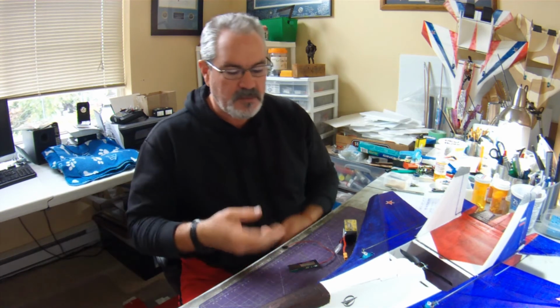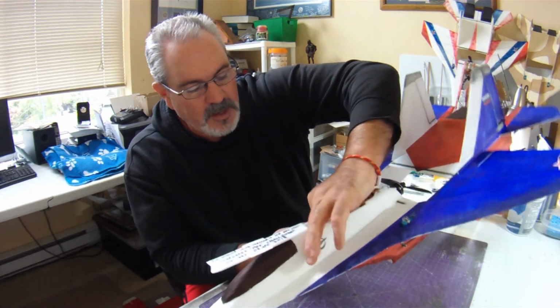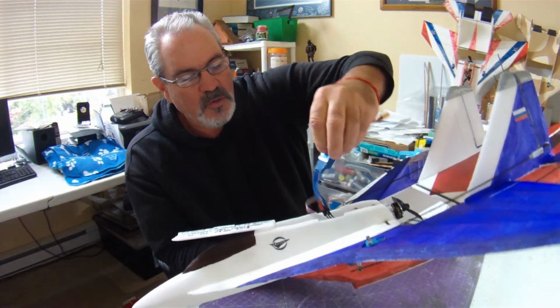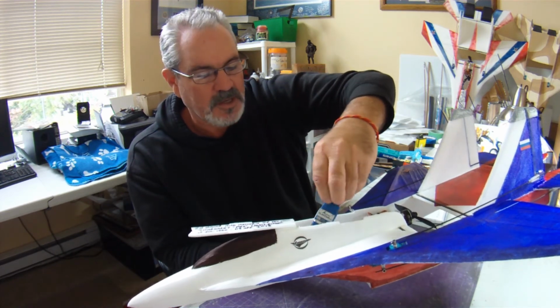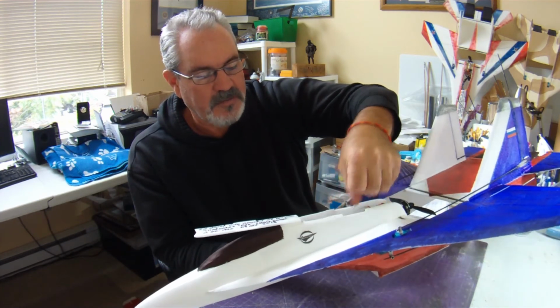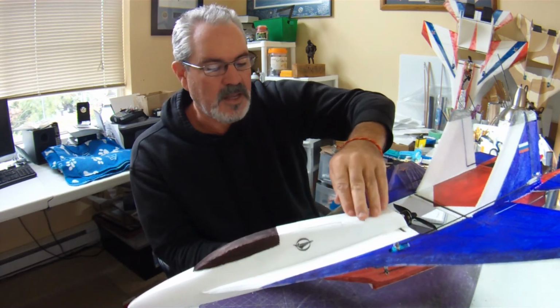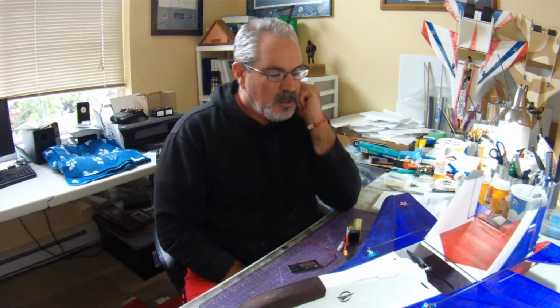We've got the GEP RC motor in here now. Same speed controller, the Hobbywing Platinum Pro, which is proving to be a real superstar. I shot a video about that as well, which I'll link down below. Custom settings of 26.25 degrees on the timing and 8 kilohertz again on the pulse width modulation frequency. All right, so there's the update on the Project 100 mile an hour park jet.